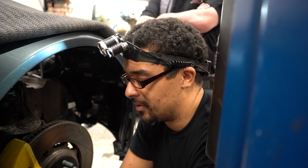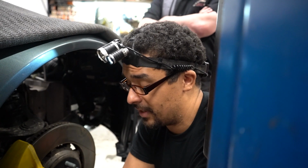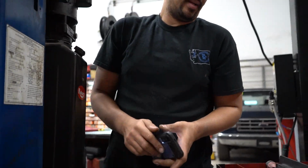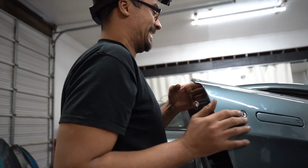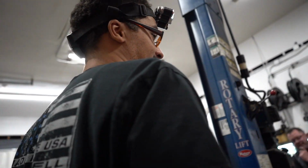So what I'm gonna do is plug it back in, recheck these, what I believe to be floating grounds, and go from there. But that'll essentially be the last step before condemning my replacement ECU that I paid an Aston Martin technician to come out here and program on site.